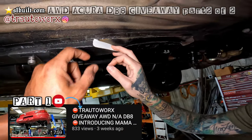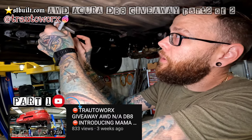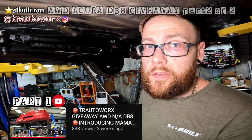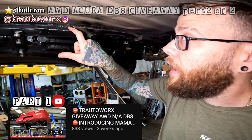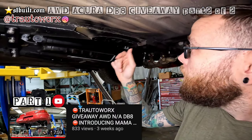Shaped out in cardboard, and then we're going to go shape it out, get it made. So we're going to go ahead and from here basically just get the shape and everything that we want, and then I'm going to transfer this over to a piece of stainless and then go ahead and cut it out by hand. And then after that, we'll go ahead and clean up all of this undercoating all around here, and then go ahead and weld that in place on both sides.